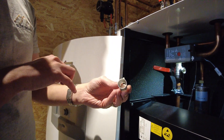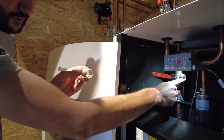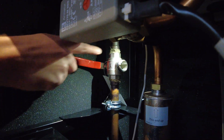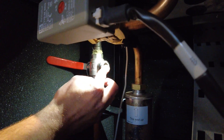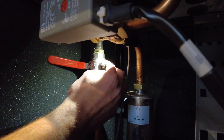There are two little locating tabs on the filter. These will line up with little notches inside — there's one on the side and one on the top. Put it back in and it will line up, and these notches will then push into place. If they're not lined up you won't be able to push it in.